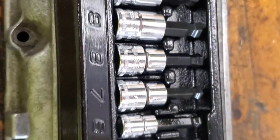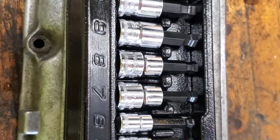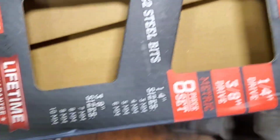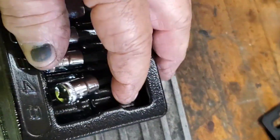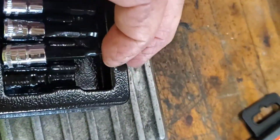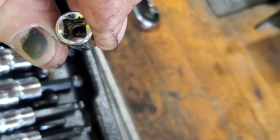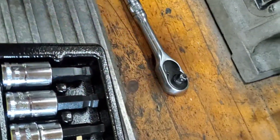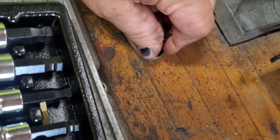Here's a bonus segment — to adjust the valves. I stopped by Harbor Freight and got a set of ball socket hex keys, metric. The small ones are quarter-inch drive but they're too long as-is. What you're looking for is a three millimeter. I put it in a vice, used a punch to knock the actual bit out of the socket, and cut maybe half an inch off of it to make it the exact length needed to adjust the valves — and it actually works quite nicely.